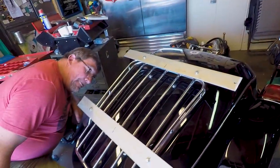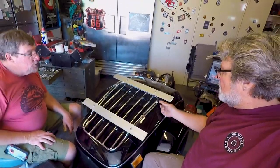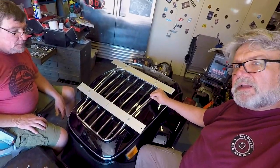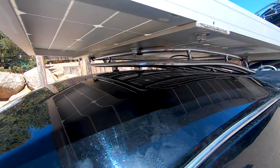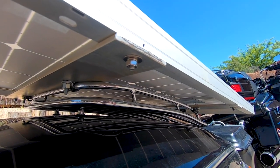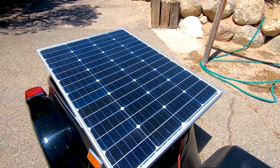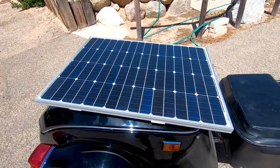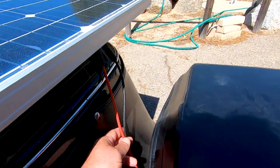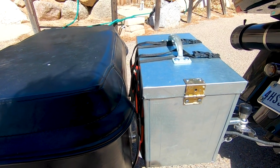Now let's get over to the panel. Here we are getting ready to mount the solar panel. We have two flat pieces of lightweight aluminum bolted to the rack via little clamps, rubber isolated. The panel is mounted onto the rack on top of the Bush Tech trailer with those rubber isolators and quarter-20 bolts mounted to the frame of the solar panel. The solar panel itself is an HQST monocrystalline solar panel, connected by a 12-foot wire that I've got routed under the cooler and then strapped to the back of the box that has all the components.